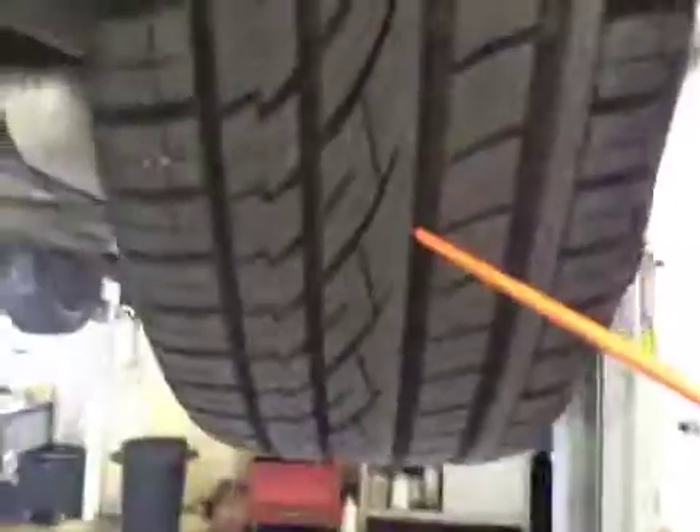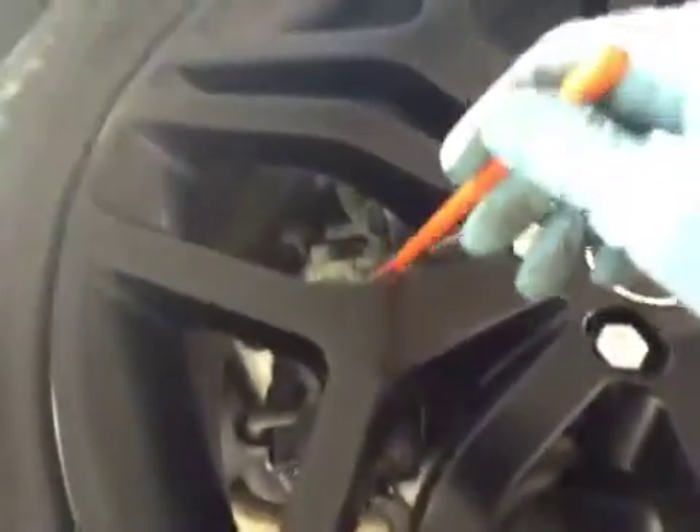Driver's rear tyre — tyre's green on the V8C. No signs of foreign objects inside the tyre. Rear disc is in okay condition, and your rear brake pads are on about 9mm. So pads are green, disc green, tyres green.